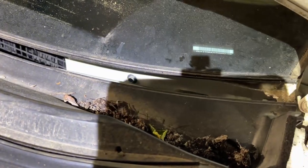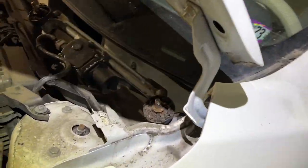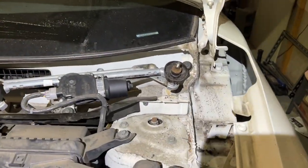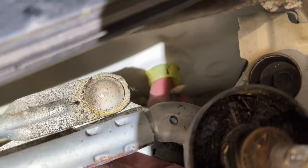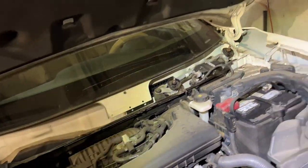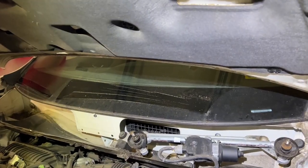The drains look very fungusy. So one of the drains is behind here — you see it, that plastic drain right there in the center. That's the one on the driver's side. The passenger one looks like it's running a little bit but you can see it's clogged. Apparently there's some kind of filter plug in the center that Nissan put on there, and of course a couple of years of trash running down clogs it up. I saw another video where he just pulled them out and left them out, and I'm doing the same thing.